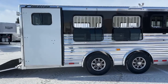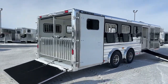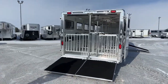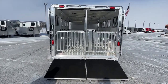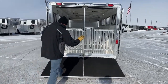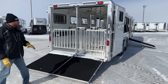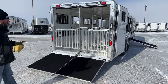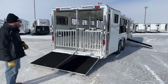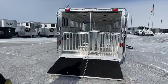The big thing is always just looking at your tow vehicle and making sure you understand its towing capacity. A lot of these new trucks all have the integrated brake controllers, so that's a simple process — if not, you need to do an aftermarket. One thing we've been doing the last few years is these wraparound hinges. The old style is a welded hinge where these doors just kind of 90-degree off the trailer, so if you're showing off and parked next to people, you're constantly having to open or close those doors. The wraparound gets to the side of the trailer — it's easier getting through if you're at shows where trailers are stacked up. Wraparound hinges kind of get out of the way and secure to the side.